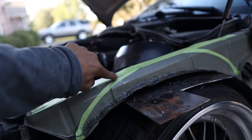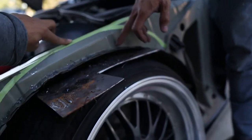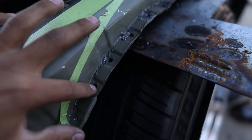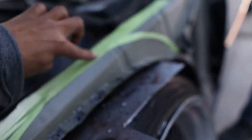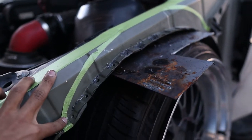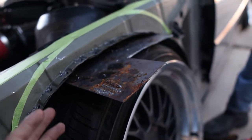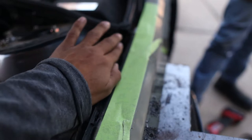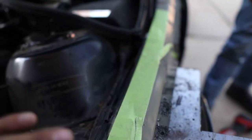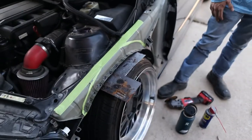Today I'm going to be cutting it out. You can tell by this drill — I'm drilling out the spot welds right now, and then I'll be cutting along this line here. We'll have to see how it goes. After that, if I want to go lower, I'll have to cut into this shock tower here and weld some reinforcement plates, but we'll figure that out later. This is what we're doing right now.